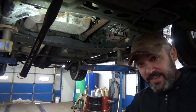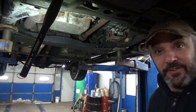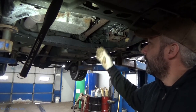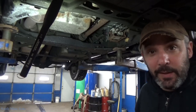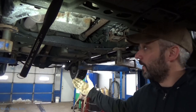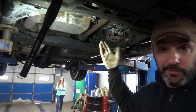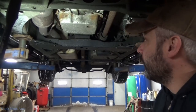Now this is probably one of the most heated, debated topics on the internet. I don't know if that's true or not, but it's one you tend to get a lot of hate on your videos. What we do — this is normal maintenance as most people do or should. You remove the pan, drain the fluid, replace the filter, put the pan back on, fill it back up. Pretty standard. We all know it does not replace the entire capacity of the transmission's fluid. Same thing when you change your engine oil — you don't get it all out. Same thing with transmission oil; the ratio is a little bigger. But if it's done as normal maintenance, no big deal. Now that we've cleared the air on that, we're going to get started.